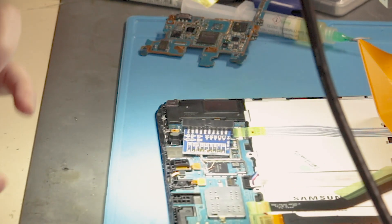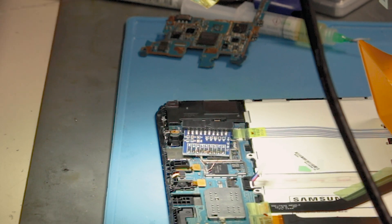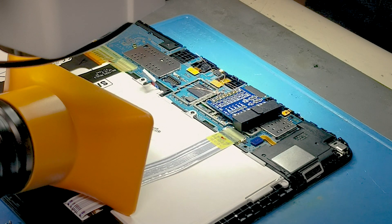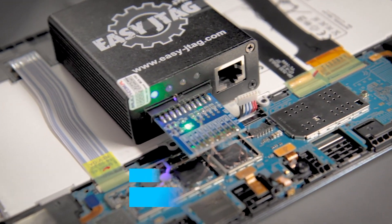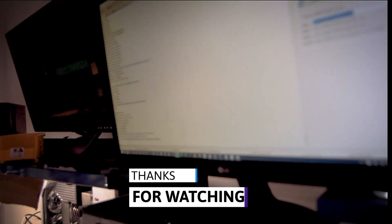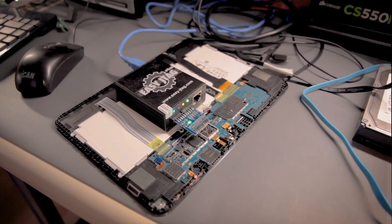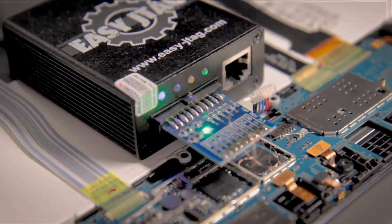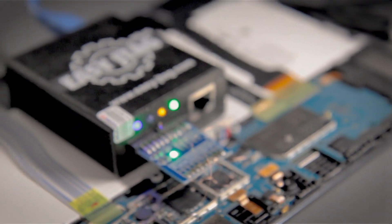If we didn't get a read on this trip, then the eMMC is dead. I didn't record the soldering on camera — sorry about that. ISP is going; the chip is detected and it's reading now. The rest is the usual stuff — it goes to eFAT and then I decode it using a physical analyzer and dump the data. That is the job done — simple job. I don't get these that often anymore, but I still do. Subscribe, like, and comment — it really helps the algorithm, and I'll see you in the next video.